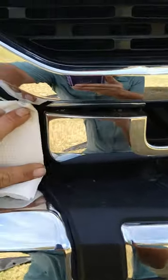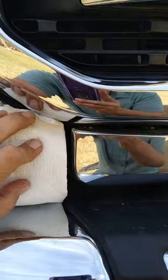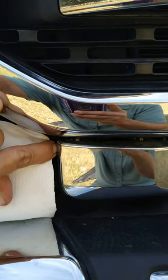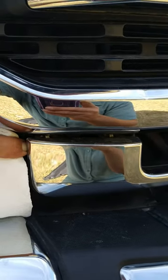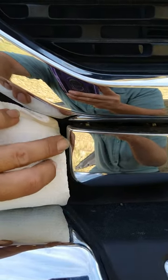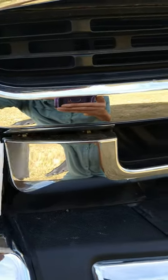I took a pad and padded next to the light right here. Basically just held this into position, put a screwdriver in right here at the corner at the top, and pry out up against the headlight. You don't really want to go too far too fast — even steady pressure — or you may crack that headlight. You can also put a bar of plastic across here to distribute the pressure along this line so that it won't crack this corner piece of the headlight right here.